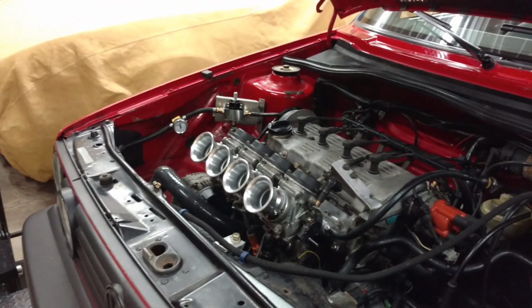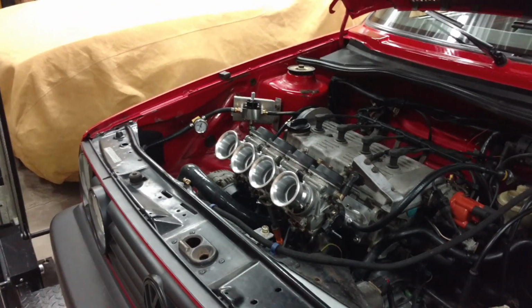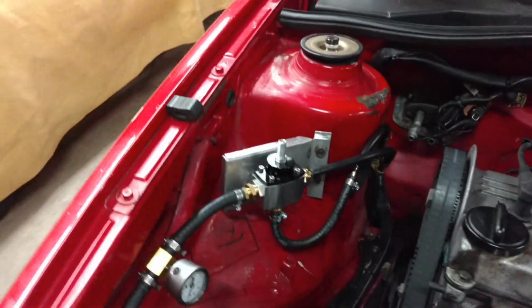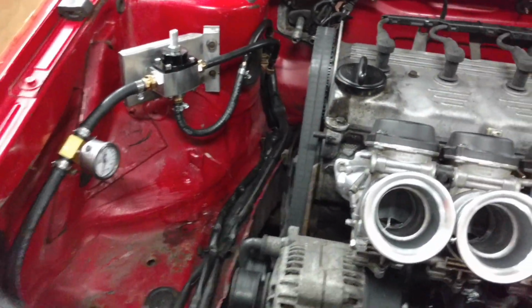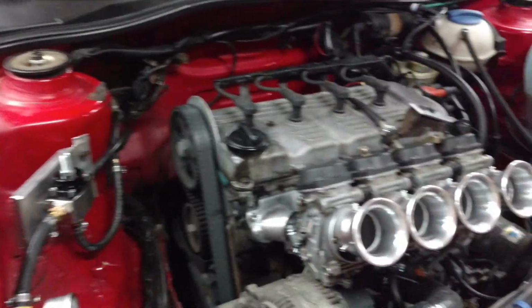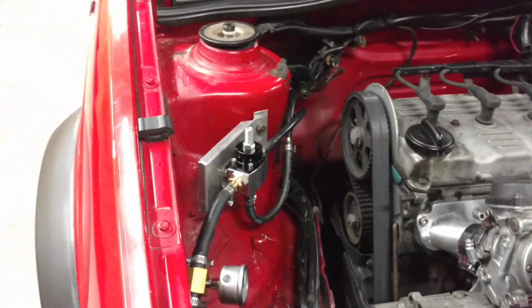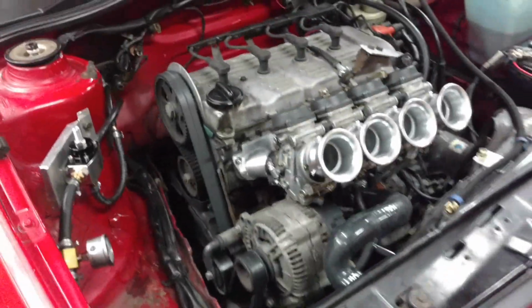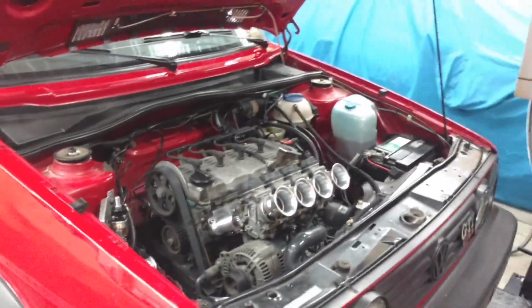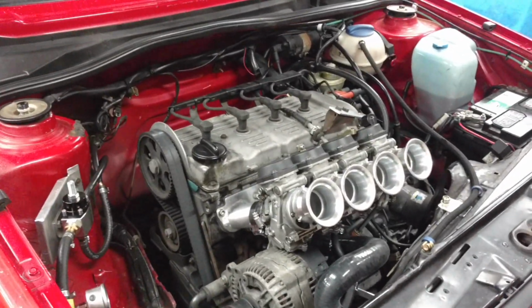Alright, Jim, when you rev it up, your fuel pressure is going to go way up. Okay. So, a different regulator. Also, your regulator's leaking as well. That's not going to matter because I'm replacing it. Yep, you're going to replace it. So, freshen up the carbs. Sounds pretty good. Do a regulator on it and do some tuning. I think it's going to come out really well. So, in the last part of the video, we'll show you a running, driving car.